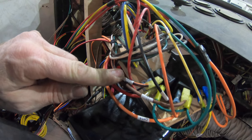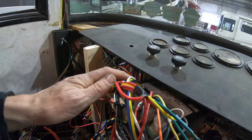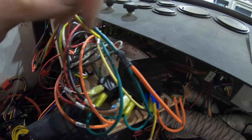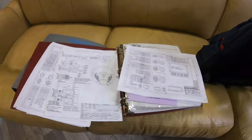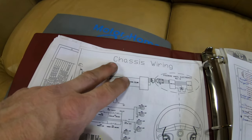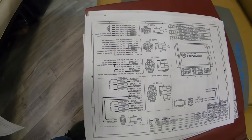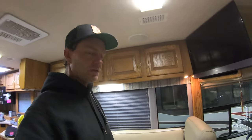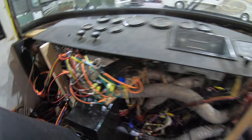You'll see I've got Country Coach wire labels — I had rolls of those left over from a previous connection to someone who worked in the dash department. Everything is labeled appropriately. I've got the relays for the headlights, the relay for the horn, and the horn fuse. I've also updated the owner's manual with a blueprint — this is the chassis wiring for the VIP module — plus a factory Country Coach print, so anyone can troubleshoot this down the road.